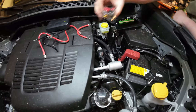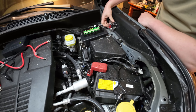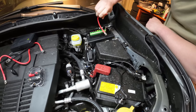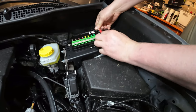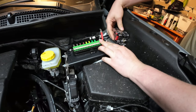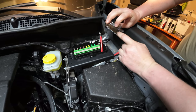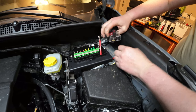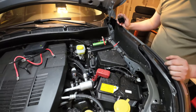The positive does not go directly to the power panel — it goes to the resettable fuse, which will mount to this plastic. On the other side of the fuse, you use the short red wire, which goes from the positive terminal down through the hole to the resettable fuse. It's usually helpful to notch out a little bit of this plastic — leave the clip, definitely leave the clip — but you can notch the rest to get an easier angle to attach that.